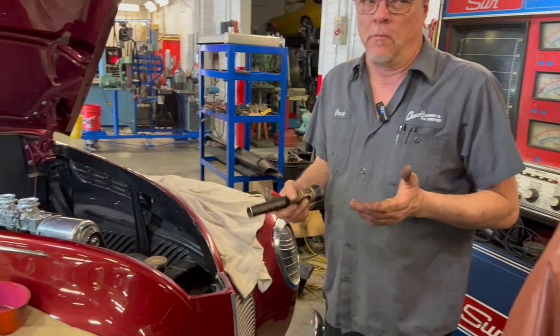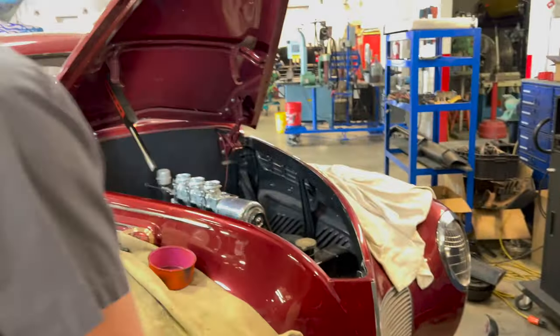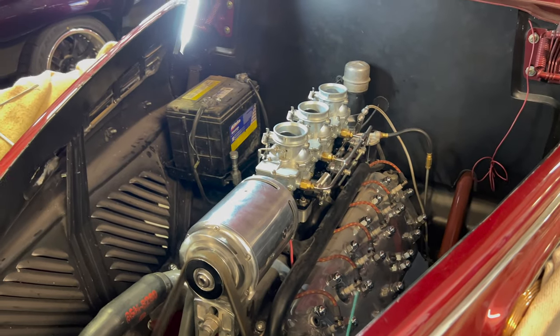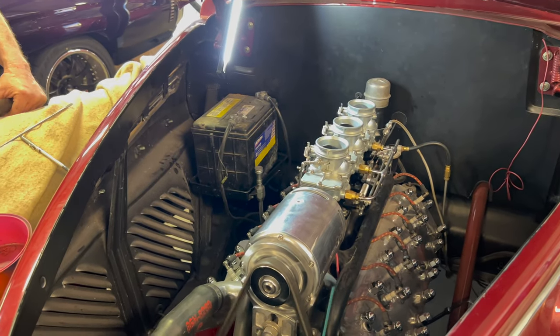Okay. I mean, you got 500-600 RPM drop. Usually, I want to see 200-300 RPM drop. Yeah, too much. Quite a bit. So, does that mean that potentially we need to redo the tranny, or I would question the torque converter that's in it? I would want to know more about the torque converter because there's such a huge drop in RPM. Think about your car at home, 800 RPM in neutral, 600 RPM in drive. We're 1200 down to about 500 in drive. It's a big drop. I would kind of wonder about that. Is it something we can just live with, or should we dig into it and fix it, in your mind? It would be more drivable if it had a 200 to 300 RPM drop from park to drive.